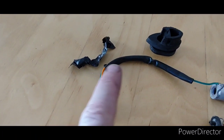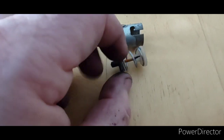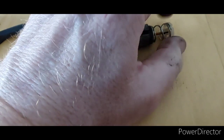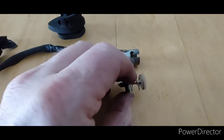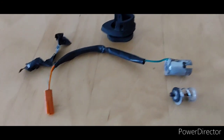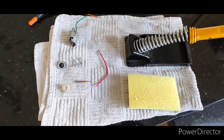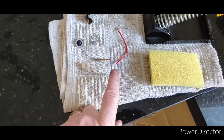This gold wire — or yellow wire — is somewhere in there, and it connects here at the end. And this wee bit goes through to the contact. This lives inside there, and a little spring pushes on the bulb and holds it in place. So I'm going to strip all that back, re-solder a new piece of wire, and solder it back on somewhere along here. That will save me having to replace all of this — reuse, repurpose, and all that.